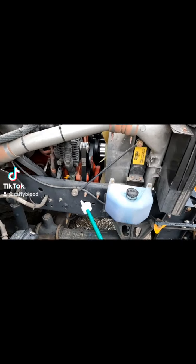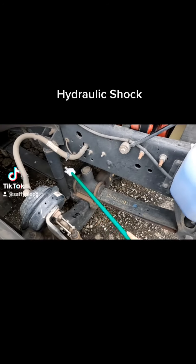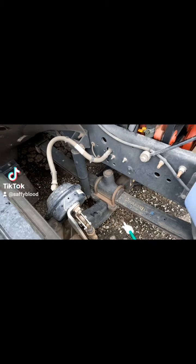We're making sure that the leaf spring hangers — front and rear — are secured to the frame with all bolts present and tight, and secured to the leaf springs with the fasteners. Then we're checking our hydraulic shock, making sure it is secured to the frame and to the axle with all bolts present and tight, and since it's a hydraulic shock, we're also making sure there are no leaks.